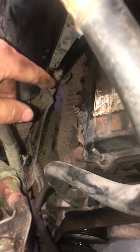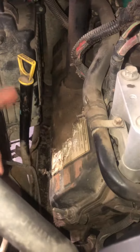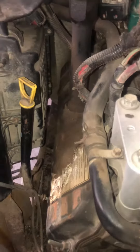Move all that out of the way. I'd start pulling the glow plug rail off — the first two usually come out pretty easy up here. Then you go through your fender well; there's a hole and you start pulling the other two out. I ran into a problem where this air box is in my way, so I talked to some guys on some forums to figure out how I can get around removing that air box.